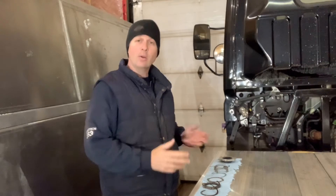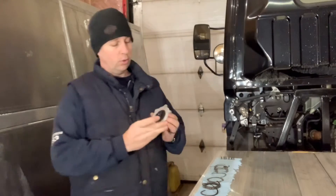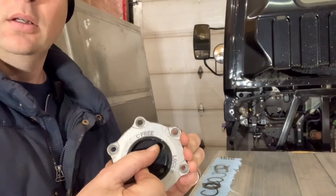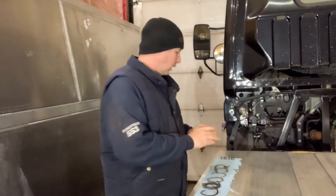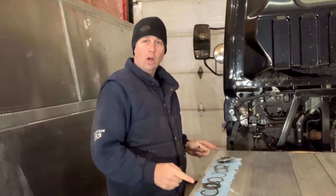There are a number of reasons why you may need to take apart the outer portion of your locking hub. One of the most common is when you try to turn your hub from free to locked and you find you can only go halfway — that is because somebody at some point has assembled these components in the wrong sequence.